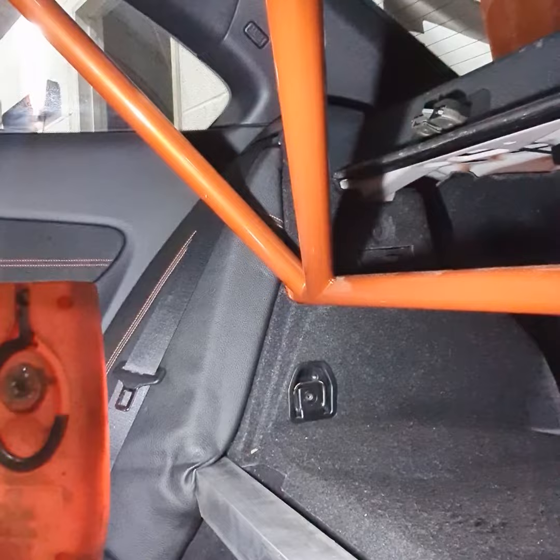The cage is in the car now, all buttoned up. You can see the hoop foot plates are here and the carpet is sitting in nice — I've gone ahead and put the boot carpets back in as well, trimmed out as mentioned earlier. A couple of tips for this stage: you want to put the rear section in the car first, then bring the hoop section in. On the 1M that wants to be done from the driver's door — that can vary between models; on the M2 you're going from the rear. Put it in, put all the foot plate bolts in, leave everything loose, wiggle it into position, get it all nice and snug, then bolt everything down tight. There are only M8s on the hoop feet, so don't overdo that. Once that's in and everything's bolted up tight, you can move on to the seat panel kit.